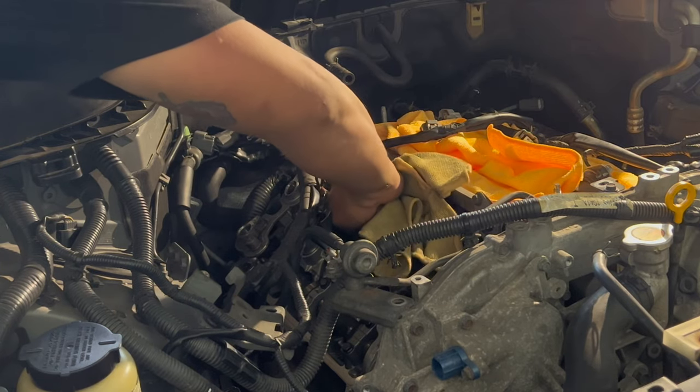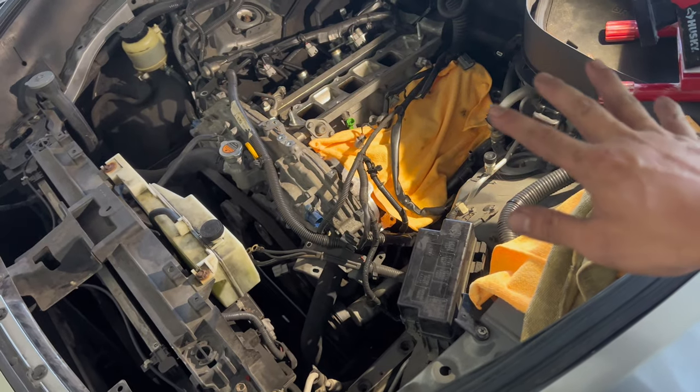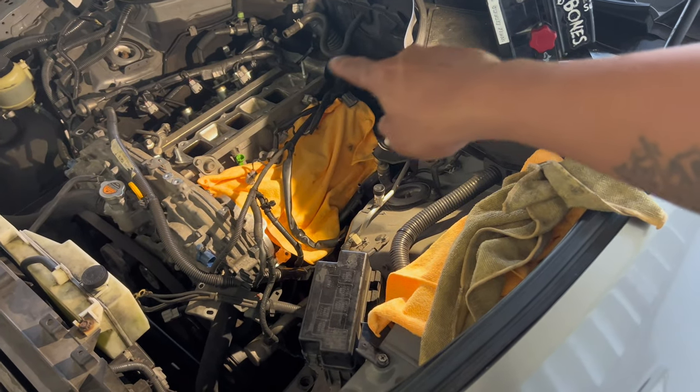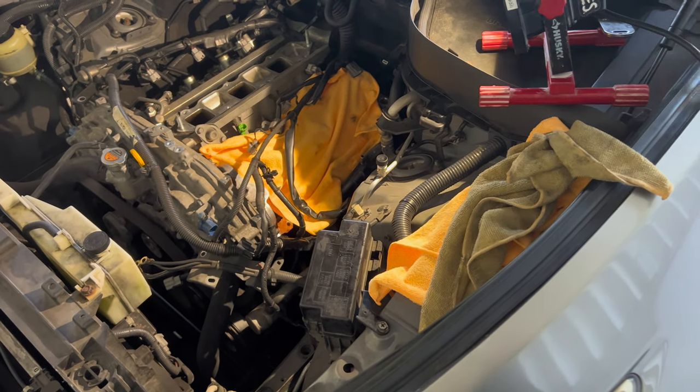If you're doing this job, don't forget to put away all those screws. Also film and take pictures of where they go and where they belong because there's a lot of screws. Even putting back the intake manifold, there's still a lot of screws, clips, and connectors for your sensors, coolant lines — don't forget to plug everything in because you might get a misfire. We cleaned down the intake manifold where the surface is going to touch, as well as the valve covers. Now we're going to put it in.